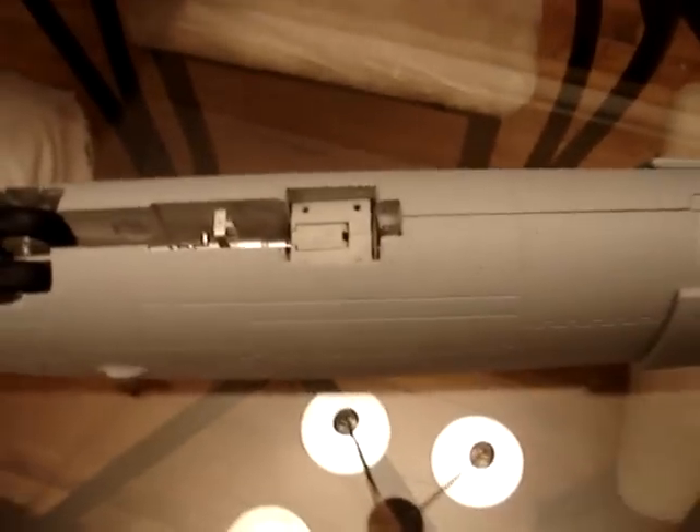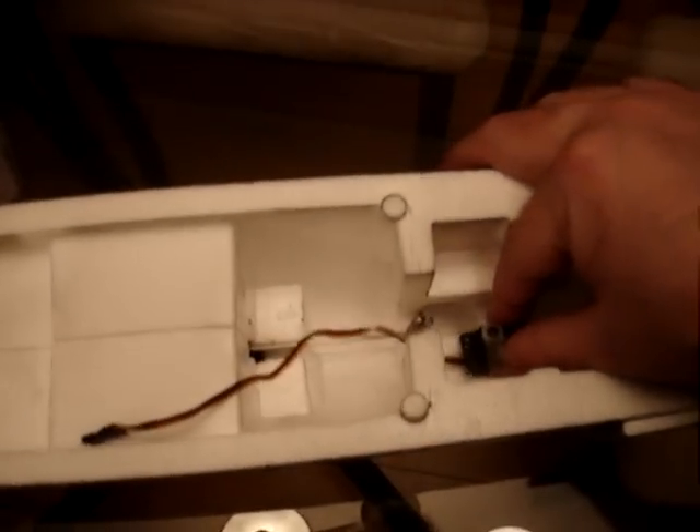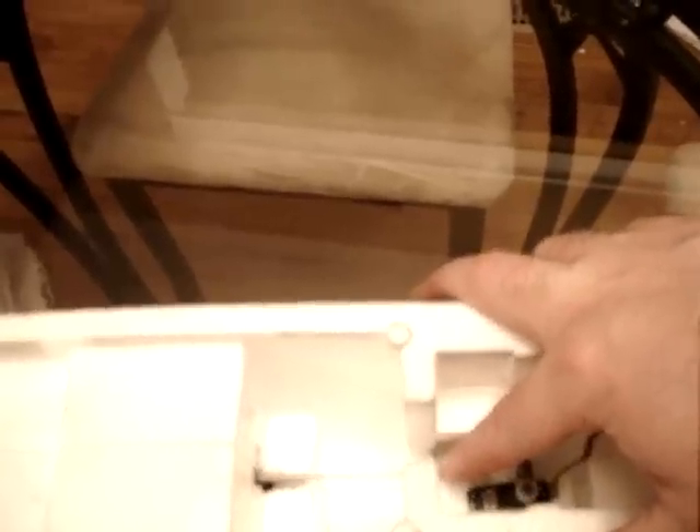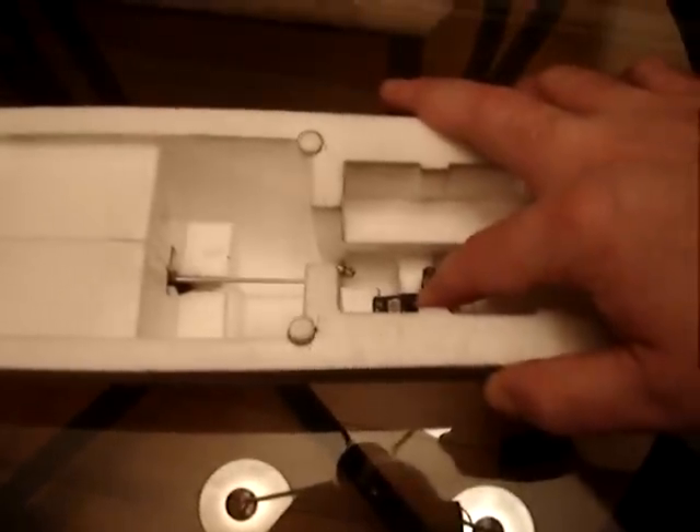Where does this servo go? We're going to flip this over, and the servo goes in exactly like this. If you want to make it a little bit closer, use a little less bar and flip your servo arm around, and you can actually have it installed this way — but it really makes no difference at all. In the kit there's an included bar that will attach from this section here to the retract unit to the servo itself. Use a very good servo and secure that servo in nice and strong — you do need a good servo to operate this.